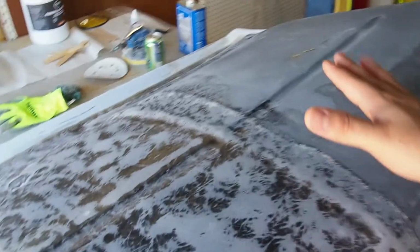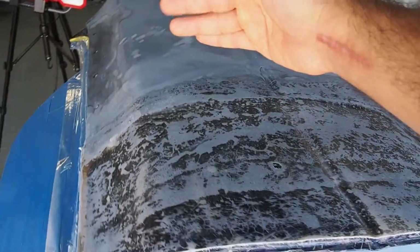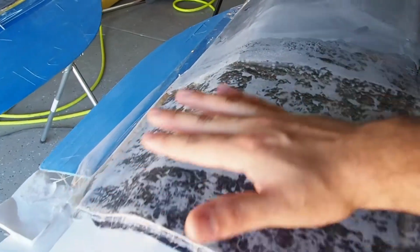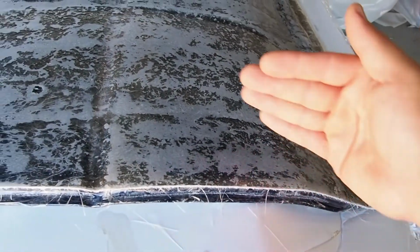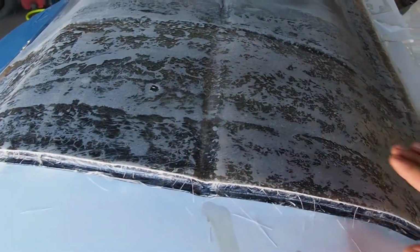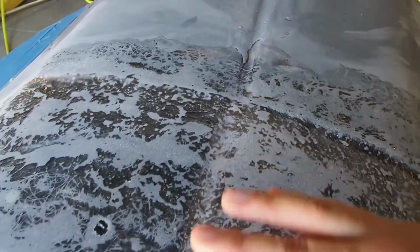But now that I've leveled it off and took out a lot of the high spots just from the fiberglassing itself, it is ready for starting to blend this shape over here. So the idea was that this is just an underneath layer to support all the Bondo I'm about to put. Essentially I'm going to try to keep the Bondo strip not too narrow but not too wide either, because I do want it to thin out and transition into the next door. So I'm just going to be sanding this fiberglass down to its thickness, and then I'll be transitioning and blending this seamlessly.